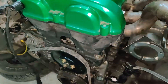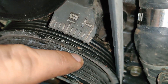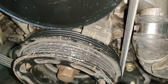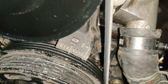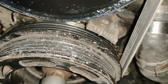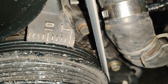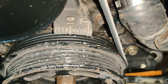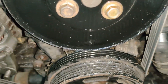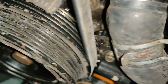I'm switching to my phone camera because it's easier to show. As you can see, those two markings are our TDC markings. On an MX5 you would think the right dot is TDC, but actually the dot to the left is the top dead center dot - you want to line that up with the T. That's the actual TDC on the MX5 or Miata. Usually if you have one mark on your pulley it will be your TDC mark.